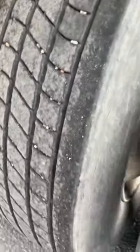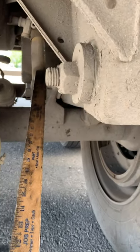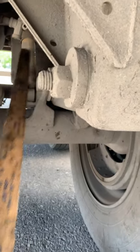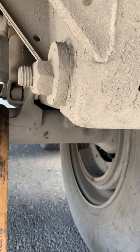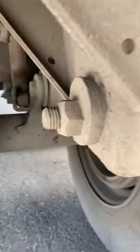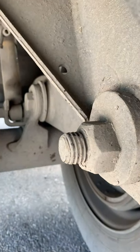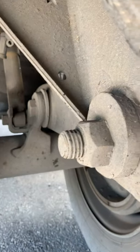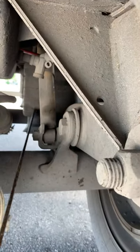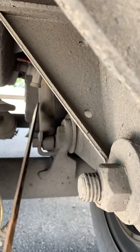Then you come down into this section — you want to sit in so that way you can actually see everything in here. From there you go to the shocks: properly mounted and secured by top and bottom bolts, bushings are intact, and not damaged or leaking. Then you go behind the shocks to your airbag support — supported from top and bottom, no missing parts, not cracked, broken, or missing. Then you go to the airbags: properly mounted and secured at the top and bottom, not damaged and not leaking from the airbags or airlines.